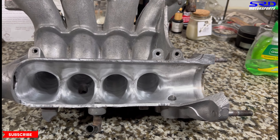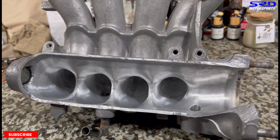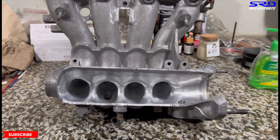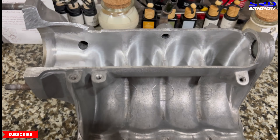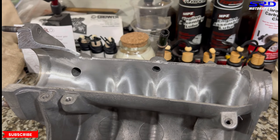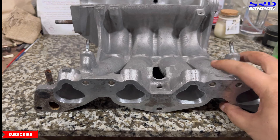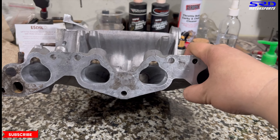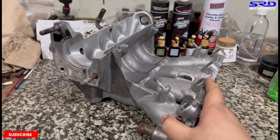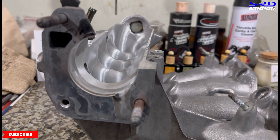Now here it is all finished up. See — the runner entries are like a bunch of velocity stacks, and it's contoured well, especially runner number four that's coming from the throttle onto the entry there. Here's on the other side — oh yeah, this is going to be performing really, really good and flowing efficiently. Even if it's just a stock intake manifold, it's going to be really good. It's ported through and through, but we left half an inch to one inch before the flange untouched. This way it can be port matched by Earl and the shop he goes to, to match the head.